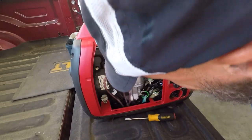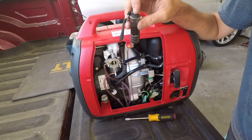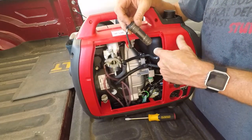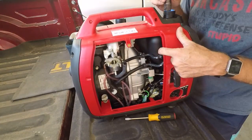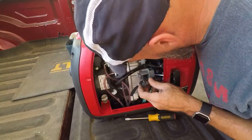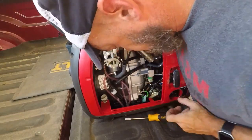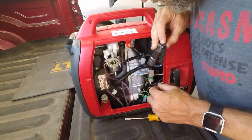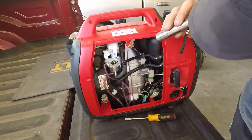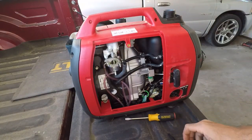The carburetor looks a little crummy. I'm not 100% sure what this is, but those go over to something that's held internally, right in here. The fuel tank itself looks very good. I don't see anything in it. This has apparently got a part of a fuel cutoff built into it, because the fuel goes through that, by the looks. So I'm gonna finish popping that carburetor off and drain the float bowl, pull the float bowl, see what I see.